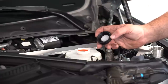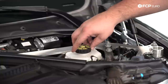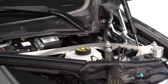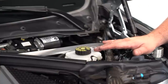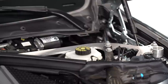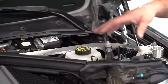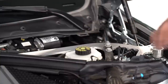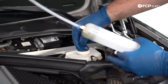When you push the pistons back in, that's going to displace brake fluid, and it's going to have nowhere to go except out the top of the reservoir into the engine bay — and brake fluid is pretty corrosive, it will eat paint. So we're going to siphon a little bit of fluid out to give us some space to work with. After installing the new brakes, we can top the fluid level back off. It's always worth checking this because if brake fluid was topped off previously with pad wear present, pushing the pistons in will overflow the reservoir. This fluid is already clean and relatively new, so we'll go from there.